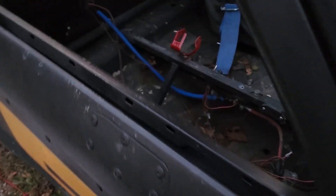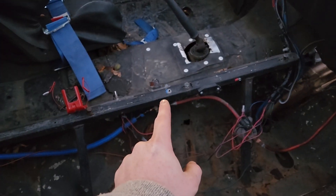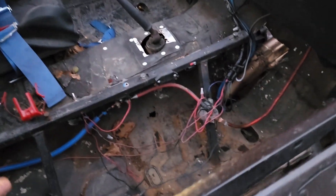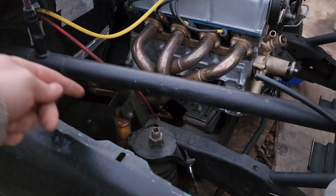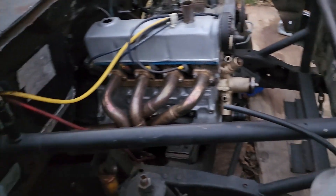If we come back up here where the fuel line's running up, you can see there's not a lot of play in there — it comes right up and tees right into it. As far as wiring goes, pretty simplified. The blue is power coming in, which goes to a master switch right here. That switch splits off and either goes to the coil or runs back to the switch and button so we can use it as a starter. That runs up and goes straight to the starter down there, which is a one-bolt starter. It grounds through the block and we have a strap coming over grounding back to the frame. Very simple, straightforward wiring.